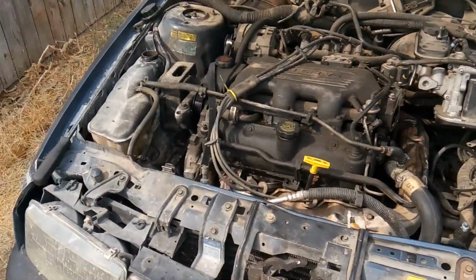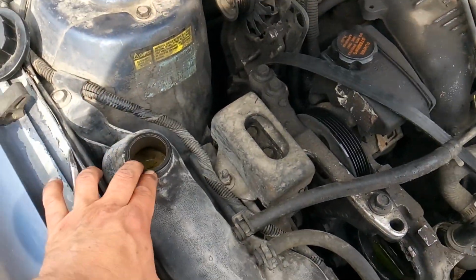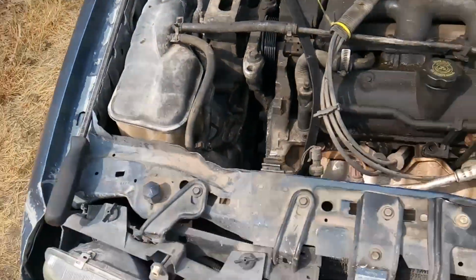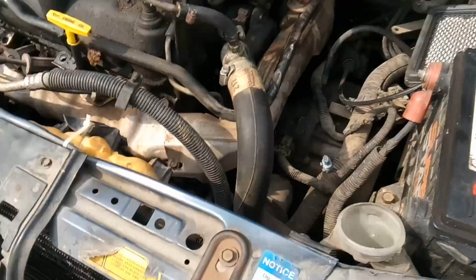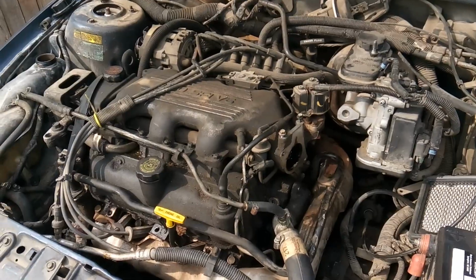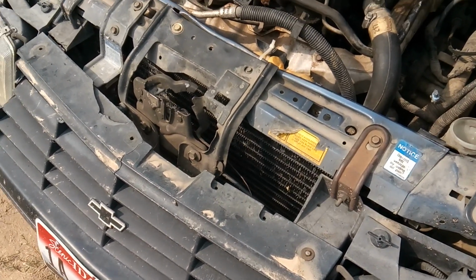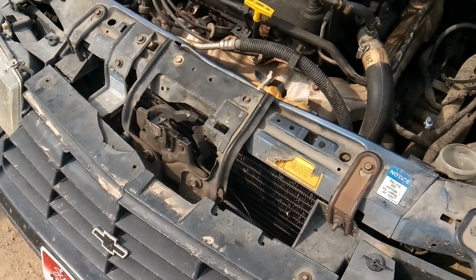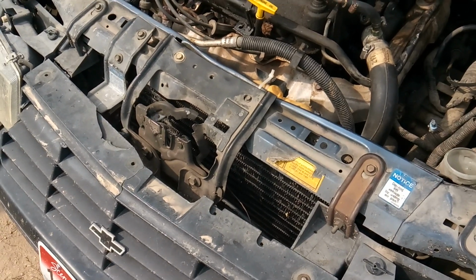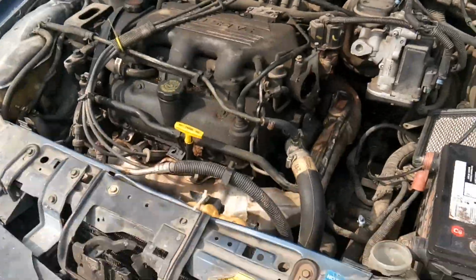So when I do pressure tests and I see that a system won't hold pressure, what I'll do is I'll do visual inspections of everything. Again, I've seen people replace head gaskets and it turned out to be a leaky radiator simply because a technician in a shop just overlooked it, didn't visually go through it and check it out. And so, you know, that's how it goes.